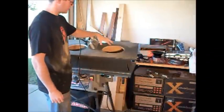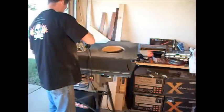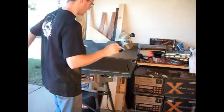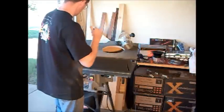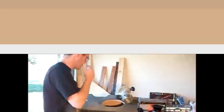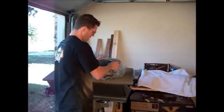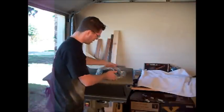We went ahead and routed some holes out a little bit bigger. We had to route the holes out for the Image Dynamics to allow them to fit, and I'm just going to finish this other one up. If you're just enlarging the holes, you just want to put a large straight cut bit on it — nothing fancy. What you can do is just allow the router to do the work for you and route it out little by little until you get it to where you want it. After about three or four tries, you'll get your router hole just big enough so that your sub can sit in there snug.